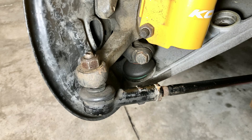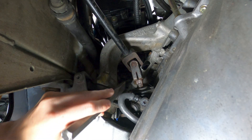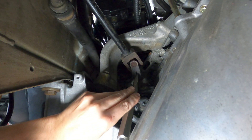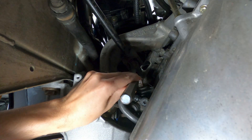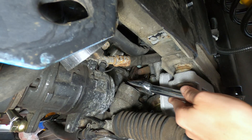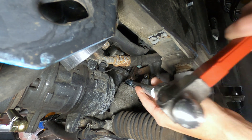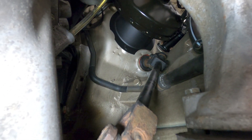When removing the steering rack from the car, the tie rod ends will need to be disconnected from the steering knuckles, and the spline shaft on the steering gear disconnected from the intermediate steering shaft. This joint can be problematic in the removal process, especially if the connection has become oxidized over the years. The 13mm nut and bolt will need to be removed from the U-joint, and then a cold chisel can be wedged into the slot cut in the side of the joint to loosen things up. A long pry bar or a ball joint separator tool can then be used to disconnect the two parts, and if efforts don't prove successful, you can always disconnect the steering shaft from its upper connection point below the brake booster, which should be less oxidized than the lower connection.